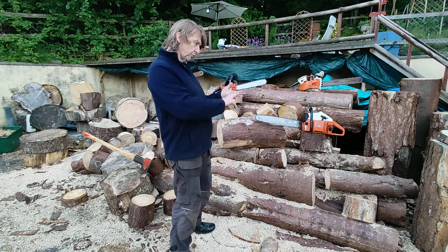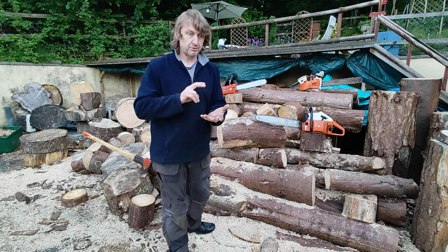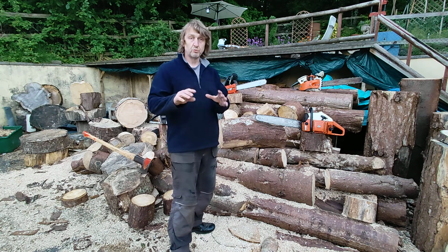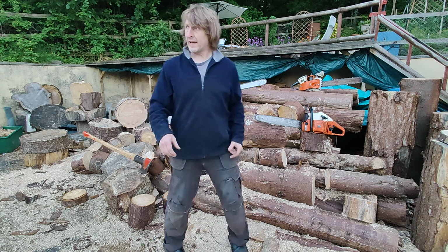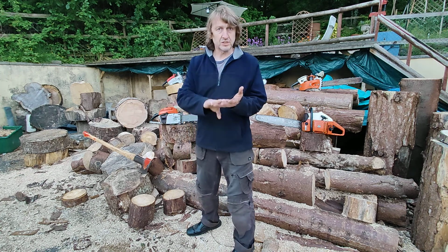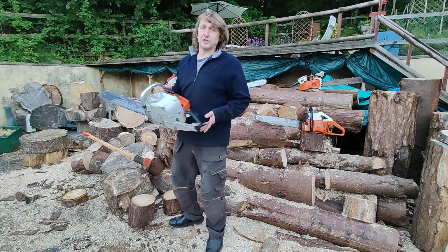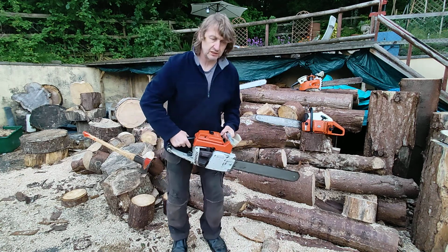Then the Rancher 61, 48, 34, and like lots of the Stihls, the 34 and the 36, all running a 34mm stroke. And doesn't the Husqvarna 272 have a 34mm stroke? The later 372s went to a larger stroke. And the S10 in the back, while that shared the same piston size as the 41, which is a 44mm piston on the early one, that's only a 32mm stroke. So this goes really unusual in that regard. Really long stroke engine, gives it a very distinctive idle.